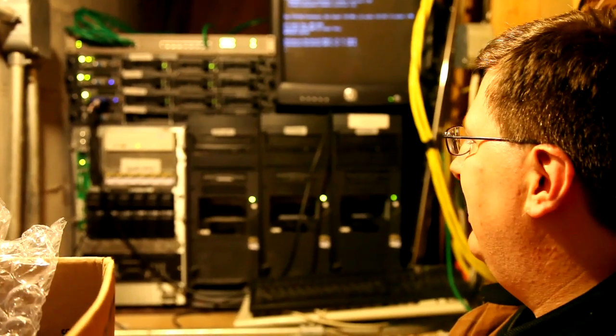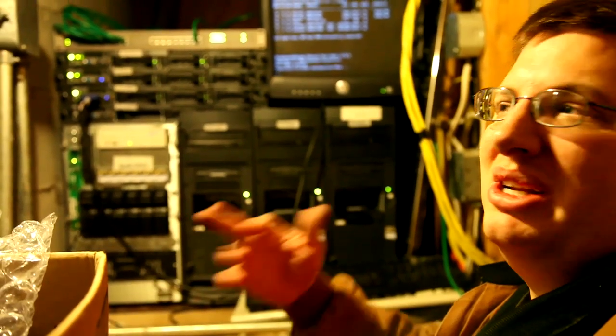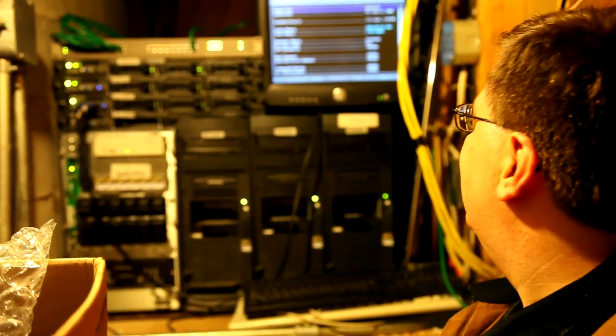The thing is that that's a Windows 2000 server — it's not going to limit the number of connections. I'm not sure if there's a limit on the Vista machine. XP limits you at ten connections, so if you have too many servers going out and grabbing files at the same time they're going to start getting blocked. I don't know if Vista has that or not.